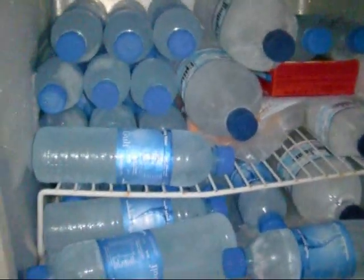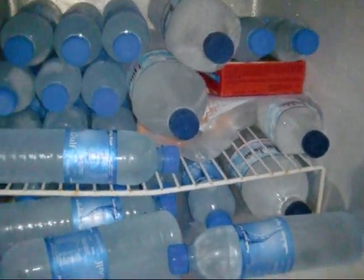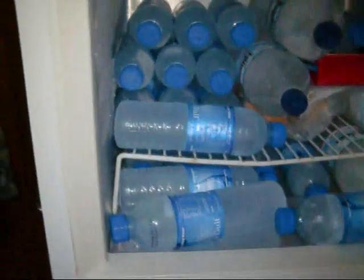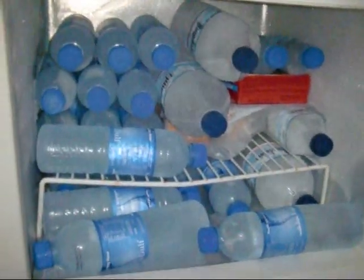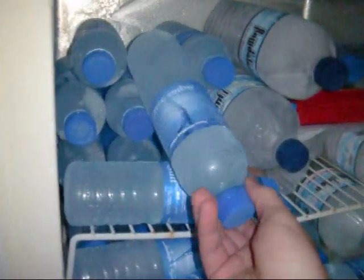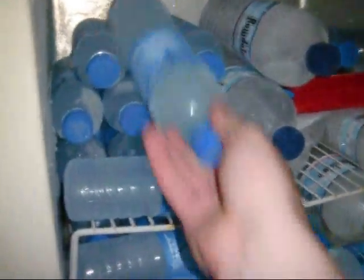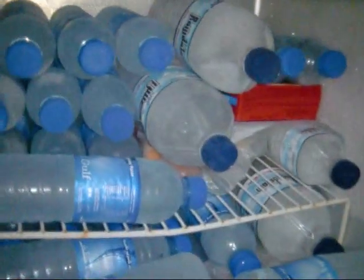The principle behind that is pretty simple. If you just have food, and right now it's a pretty extreme example because there's nothing in here but a few things — if the leftover space in your freezer is just air, anytime you open the door that cold air comes out and the freezer has to start over again to cool it down. If you fill it with water bottles, that gives it a way to store the energy that was used to make that air cold, because it's frozen in the water. So even though that cold air comes out when you shut the door again, those water bottles are still in there. It turns into sort of like an ice box.